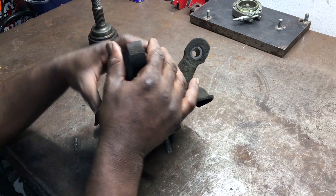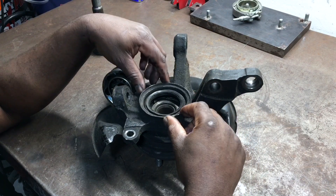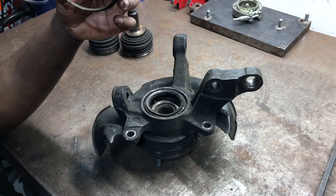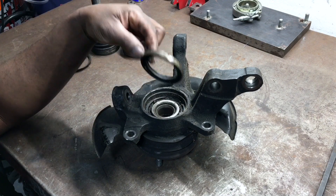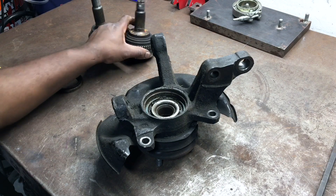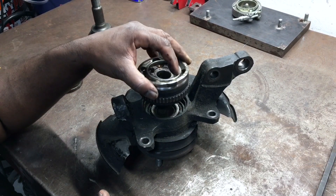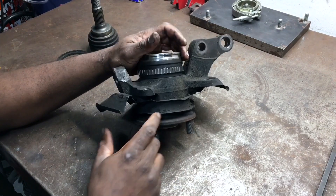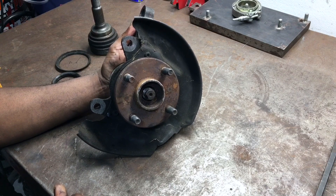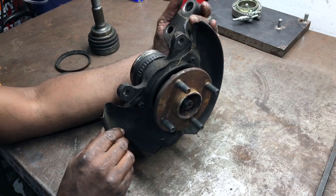I found a solution. Toyota has this ABS ring - we're going to take the ring off, which I already removed, and we're also taking the dust shield off. That frees up a little more space to get the axle in. But the problem is with the Honda outboard hub - we're getting a clearance issue around the rim of the back of the hub. You can see it's already touching. With the dust shield removed we can catch maybe five or six threads, which would be enough.